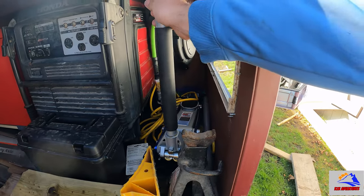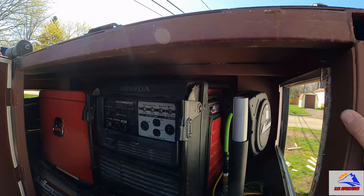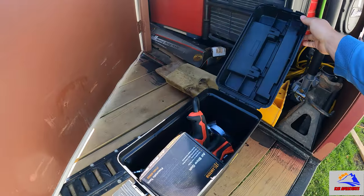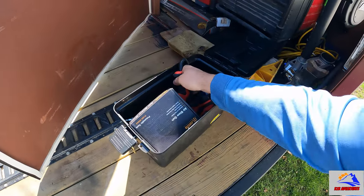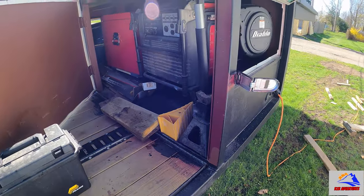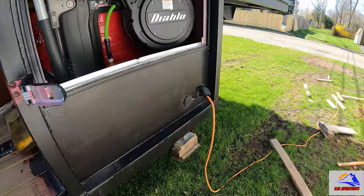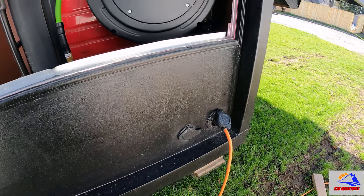I went and bought a nice light floor jack. There's an air compressor — it's all run off a power strip at the back, just a magnetic power strip. In here I picked up an electric impact gun. The plan is — and I know you might ask why plan for this, but if you don't plan you're not ready — if there's a flat tire, we roll off the side of the road, get our extension cord out, get our jack and blocks, pull out the impact gun, and fire up the generator. You see a couple plugs here: this one is for power that goes in, and this is currently plugged into the power strip for the trickle charge for the 12-volt batteries. It also powers the air compressor through that power strip.